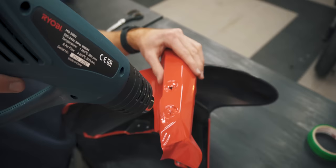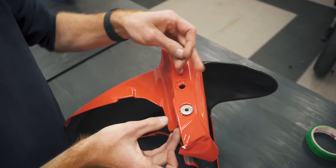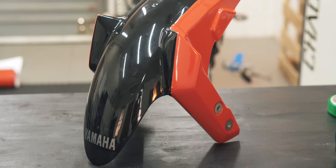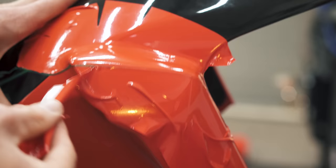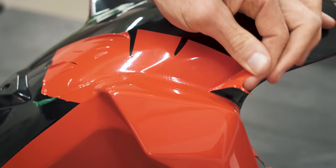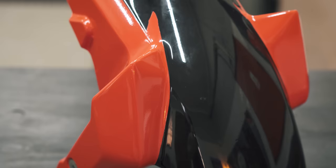It's not a tricky shape to wrap, but the bolt holes require heat to sink the vinyl and the edges around back need to be extra good since the mudguard has a tough life so close to the road. Four pieces in and it's still predominantly black. These devil horns can't really be done with any other section without a massive fight, so we'll do them on their own to make the next pieces easier.